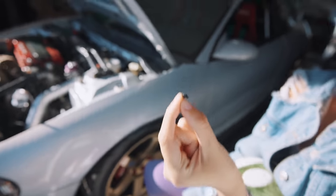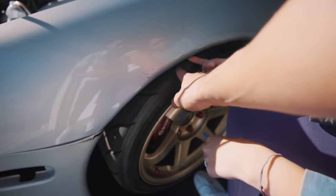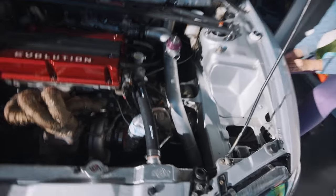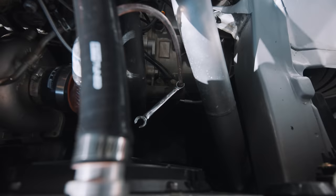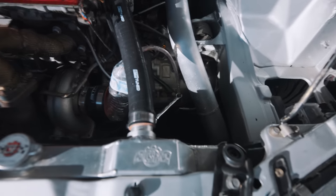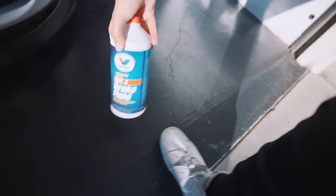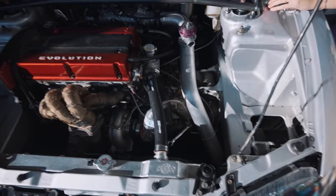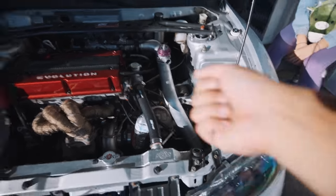This is rubber from the Miguel DSM's tire from the Smoking Tire review — this will be worth a million dollars one day. Alright, so before the bleeding process, I went ahead and attached a 10mm wrench on there. So basically you're going to put the wrench on your slave cylinder and have another person in there pumping the clutch pedal. I have some DOT 4 brake fluid here. She's going to pump the clutch pedal 10 times and hold. I'm going to loosen the 10mm bolt right there, let all of it out, tighten it back up, and she starts pressing again. It's just a repetitive process until the clutch pedal feels somewhat good.